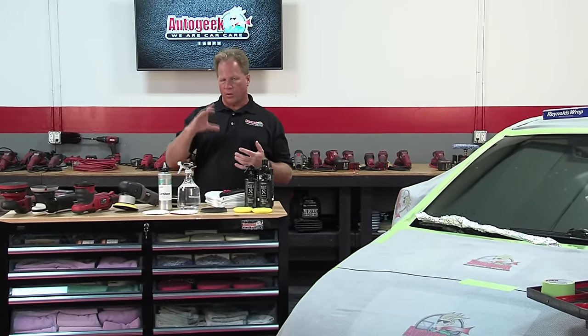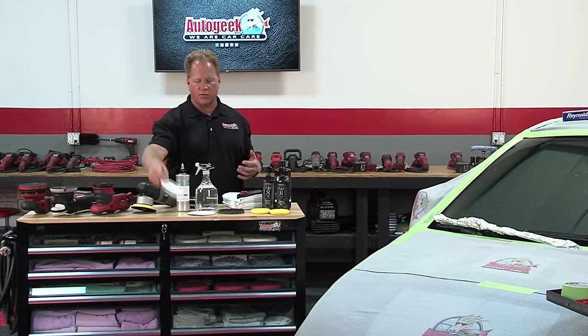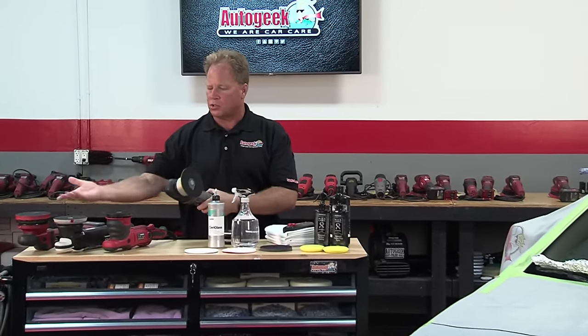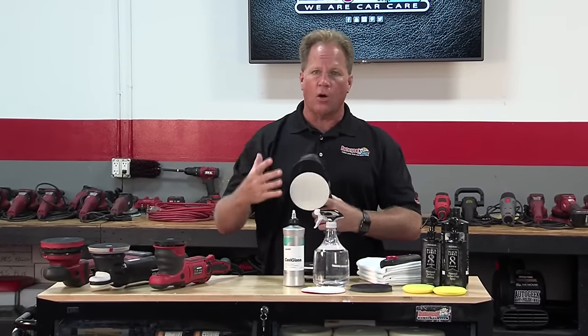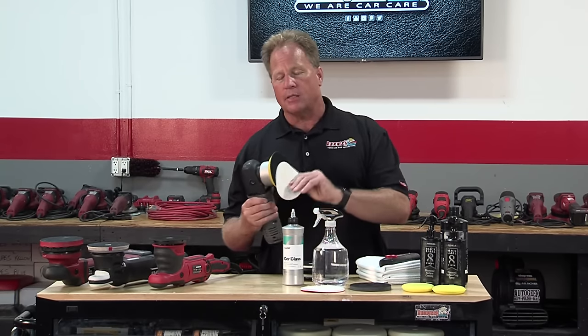It's going to maintain 100% contact between your rayon pad and the glass surface, but it's also going to smooth out the action of the buffing. For example, all these polishers have a backing plate. The backing plate's hard. The pad is thin and hard, and you put that on there and you've got this hard thing spinning around in a circle. It's not a comfortable feeling. And again, it's going to take a long time.